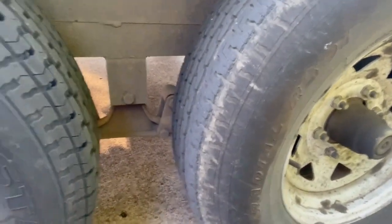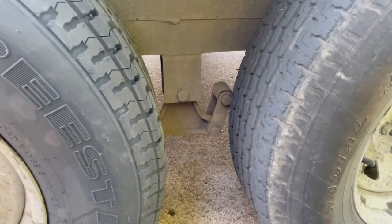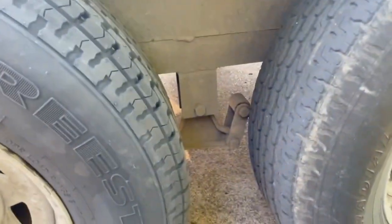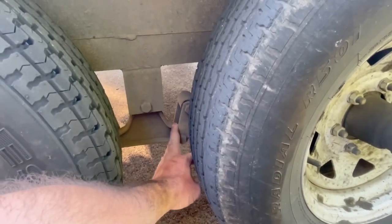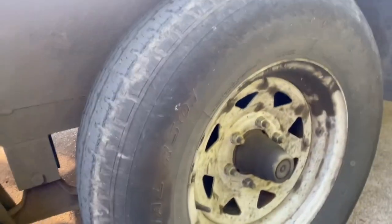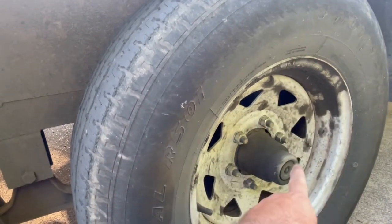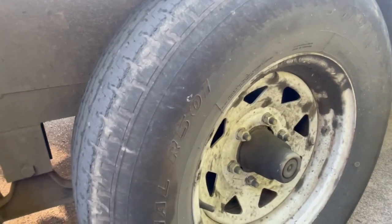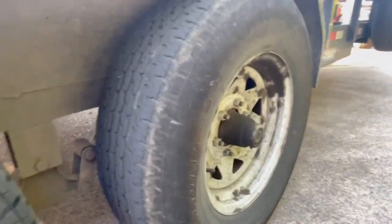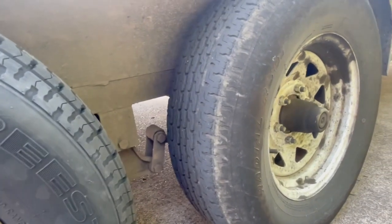As you're using your trailer day in and day out, things will happen. You need to know the difference between these squeaky noises — your trailer will talk to you and let you know what's going on. If you're going through tires, it could be the bearings, it could be this. This is something you're going to have to replace eventually depending on how much you use your trailer. In my case, I use it every day. This black stuff is just from repacking the bearings — I put a little extra grease and it shot out, I just need some degreaser to clean it up.